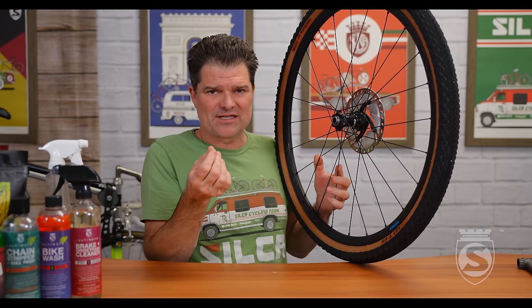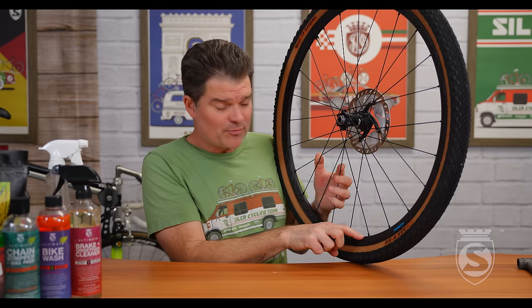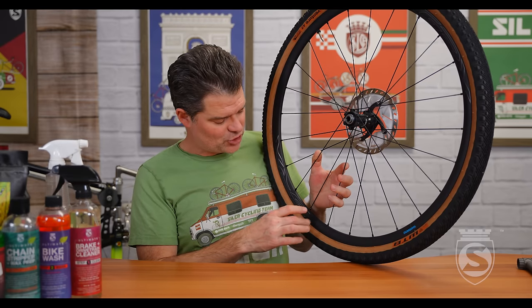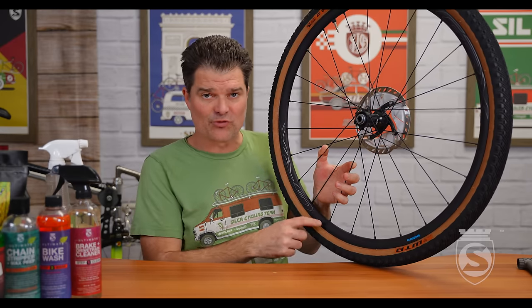Is there any white powder coming out? That's typically aluminum oxide that forms in galvanic corrosion. Look at where the spoke meets the nipple and the nipple meets the rim. Then really look at the tire — particularly with tubeless tires on modern carbon rims, look at the interface where the tire is essentially touching the rim. Modern tires have gotten so thin and light, which makes them supple and beautiful to ride, but you can get friction at the interface from the tire sidewall at the bead and the rim — and with carbon rims, which can be a little abrasive, you can over time see a breakdown of the fibers in the casing sidewall.